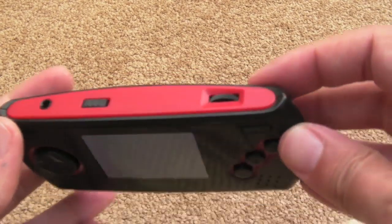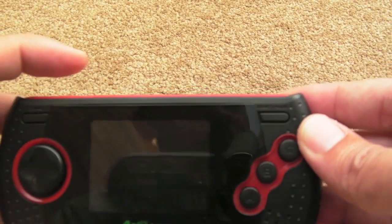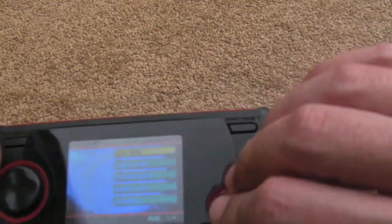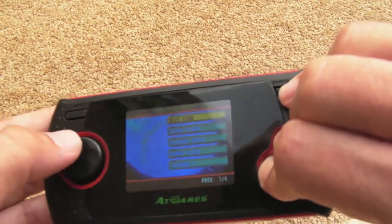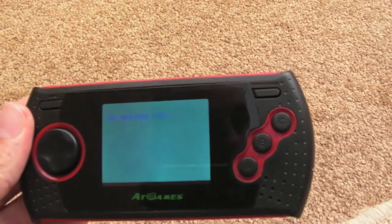But in the meantime, I'll just show you how you get into the diagnostics on this. I'll switch it off, switch it on. Right, so when it's on, hold down A, B, C and the Start button, press Up. You might even have to press the Menu button again — yeah you do. And you'll get that sound; it says 'test audio.'